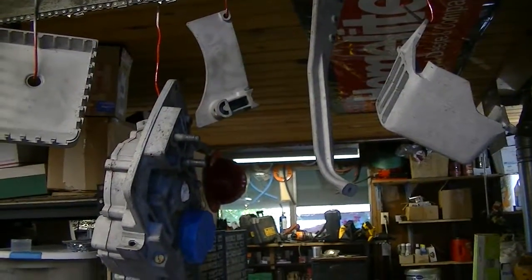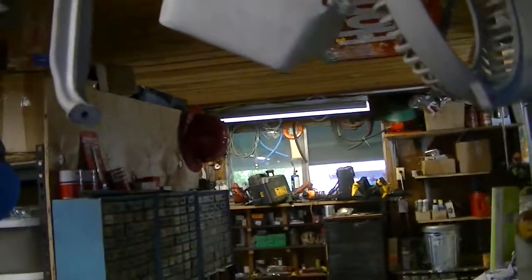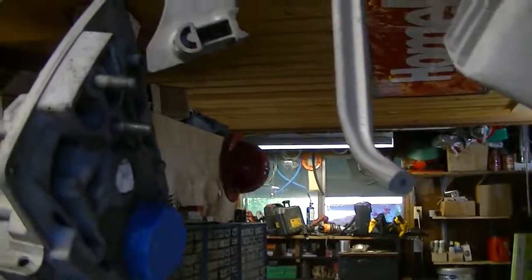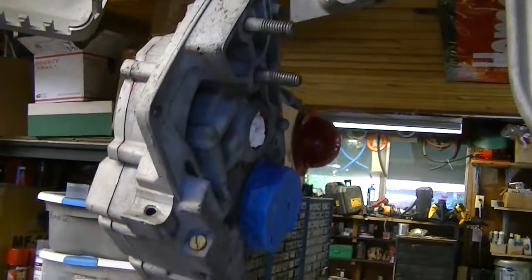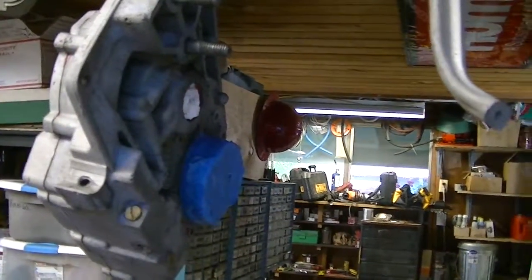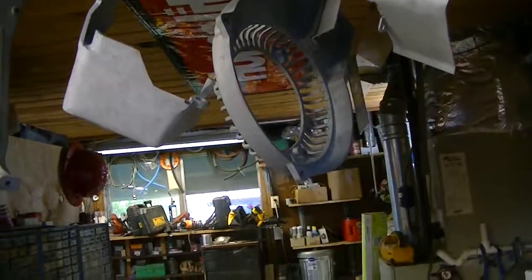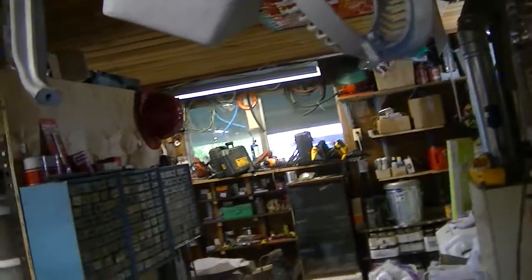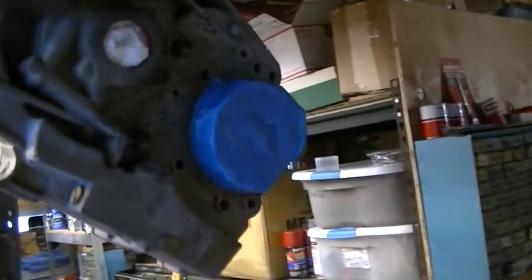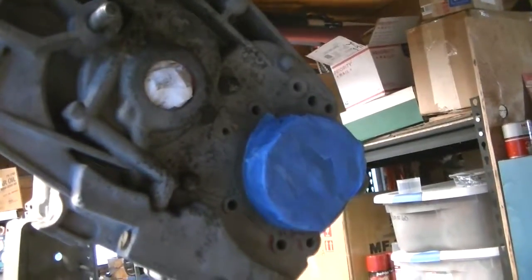They have then been cleaned again with brake cleaner, and what you want to do is go back and any of the little junk that's caught in crevices that just hasn't come out, soak it with the brake cleaner, get a little screwdriver or a pick, clean it out, get rid of it, because if you can see it, it will show up in your paint, and you do not want that. You also want to mask everything that you don't want painted, typically engine internal parts.